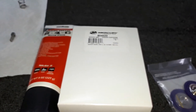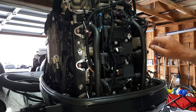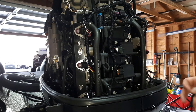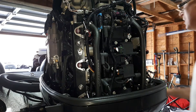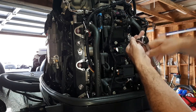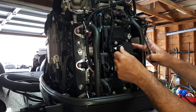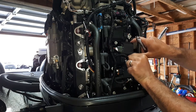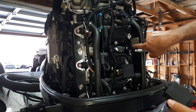Your first step is to remove this coil and remove the spark plug wires - they just pop off. I've already loosened it all off but I'm showing you guys. Take the spark plug wire off, it gives you more room. Put it off to the side. Take off the coil - it's an 8mm socket. Take the screws out, it's got a harness right here, you just unclip it. Two screws, take the bottom one off, the coil comes out and gives you a lot of room.